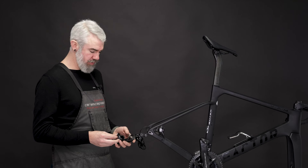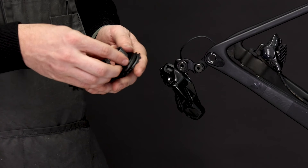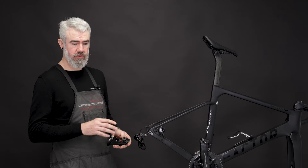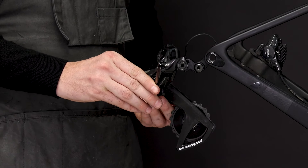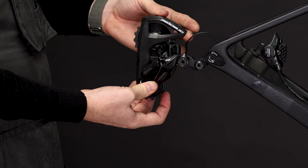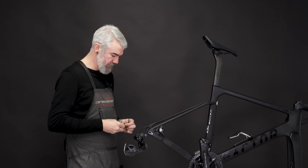We'll now use the original factory spring, and for the Dura-Ace installation, the included spacer for the body. We're going to set the spring on the second from lowest adjustment. You can use second from highest or second from lowest for general riding. The lowest should be reserved for smooth roads or time trial application, and the highest for gravel or rough road use. We'll go ahead and align up with the back of the derailleur body, aligning the post, then the spring, and the body gasket into the notch on the derailleur body. While carefully holding together, we can wind the spring tension back into place and secure it. Then replace the original Torx T10 bolt on the bottom of the derailleur body.